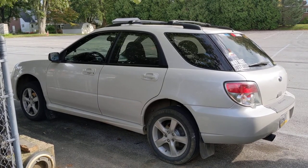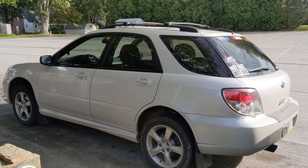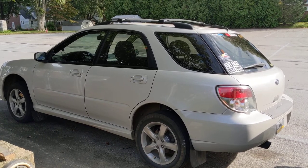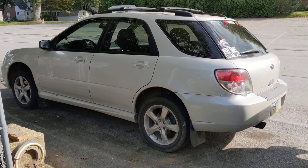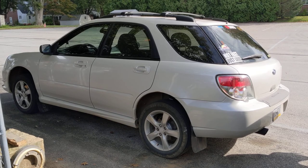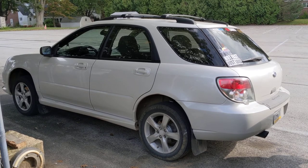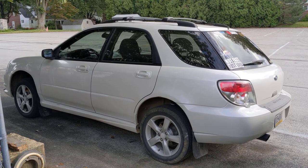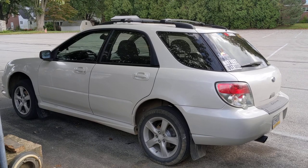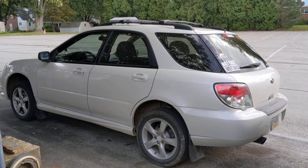It's been a little bit. The last couple videos showed how I did the exhaust. If you can tell right now, it's not lowered anymore. Two weeks ago I put on new Subaru Forester struts, and yeah, that put it up in the air a good bit. I used brand new struts from a 2005 to 2008 Subaru Forester — they pretty much bolt right in, all the top hats and bolts are the same. The only difference is it's a longer shock body, so it lifts the Subaru two inches over stock.